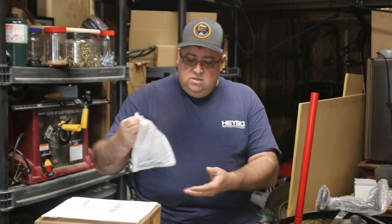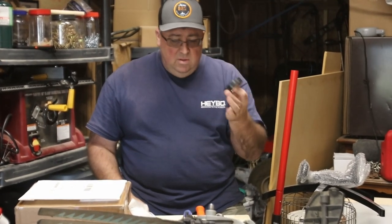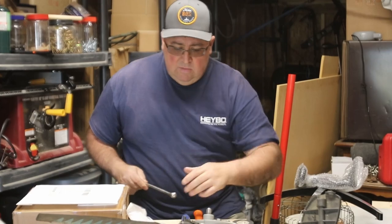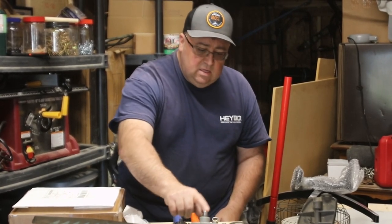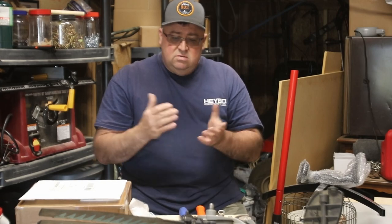I got the parts in — we've got the clevis pins and the new 180 drive. For tools, you'll need electrical tape, a 7/16 wrench to take off your cables, a 9/16 to take off the main arms, and a screwdriver for the idler pulley. The biggest thing: when you pull out the pin, wrap tape around the inside. Also be careful with the bearings — there are 15 roller bearings in this whole thing, so if you're missing one, start looking. While you've got the drive off, clean up the parts, re-grease everything, and take it back to brand new.